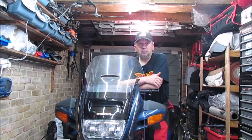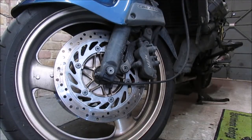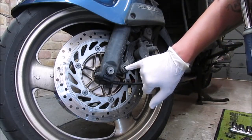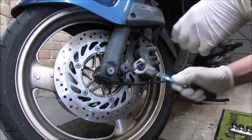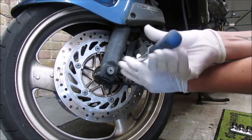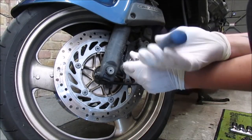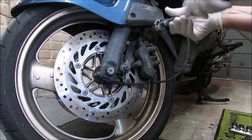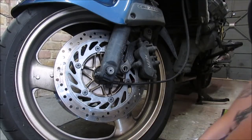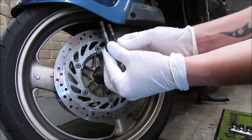Let's crack on. Very similar to Varadero brakes — first we need to unscrew this one, unscrew that one. I've already loosened them off. Interesting to see the state of these if it's anything like the rear ones. Remember to keep these in order — the bottom one is longer than the top one.